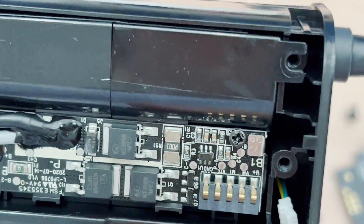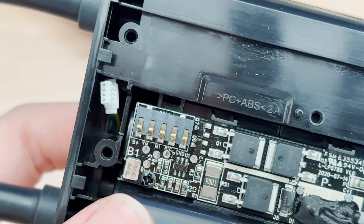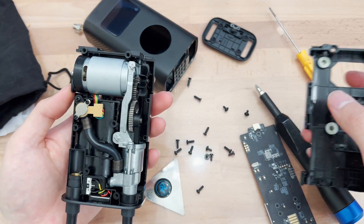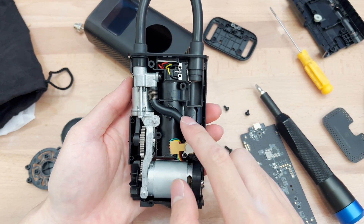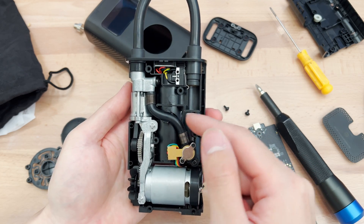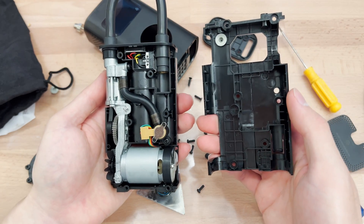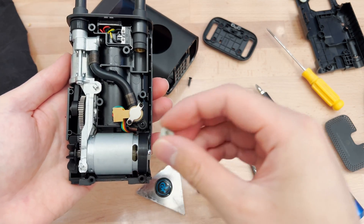They've marked these connectors: NTC, ground, M1 — so that's probably motor — and B+, supplying power to the main PCB. That comes off and it's also clipped on. Here's the inside of the pump. We have a pressure sensor with a hose running to it. You can see the two battery cells. There's a micro switch used to keep things in place, and also some rather rigid anti-vibration pads.